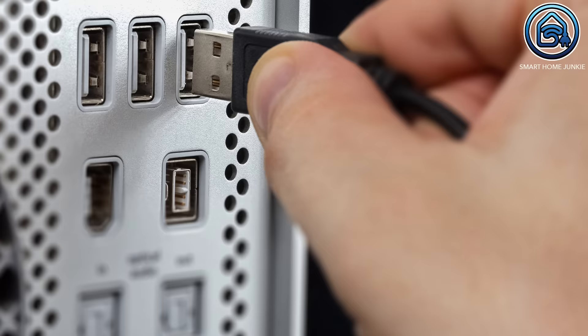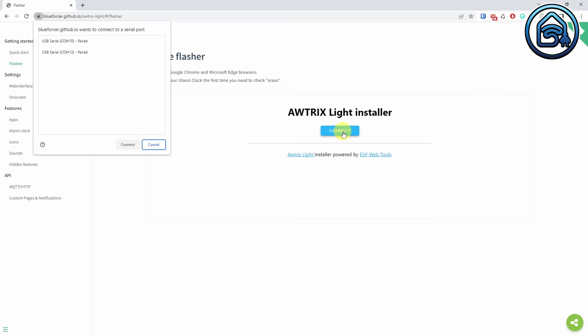Make sure that you connect the clock using a USB-C cable to your PC. If you have trouble connecting to the clock, please try to use a different USB-C cable than the one that came with the clock. Connect the USB-C cable straight to a USB port on the motherboard of your PC and do not use a USB hub or a USB port on the front of your PC. I noticed that I got the most stable connection by connecting to a USB port on the back of my PC. Now that the clock is connected, go to this page and click on Connect. The link is in the description below. Select the USB port that your Ulanzi desktop is connected to. If you do not see that port, disconnect the clock and reconnect it again — the port will show up. Click Connect.